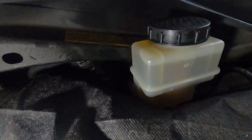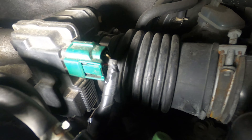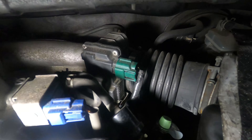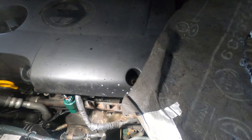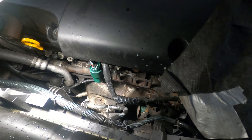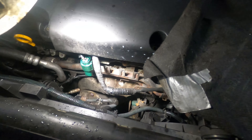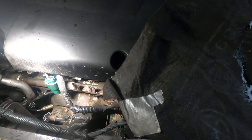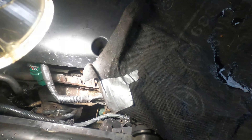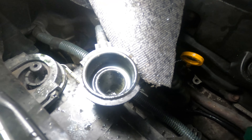There's no compression - the coil, the spark plug, it will give you a code but there's nothing. The air mass flow sensor will give you a code. I even removed the throttle body and there's nothing to it. The only thing I didn't remove is the catalytic converter, but why would I waste my time to remove it when there's no code - which would be P0420.